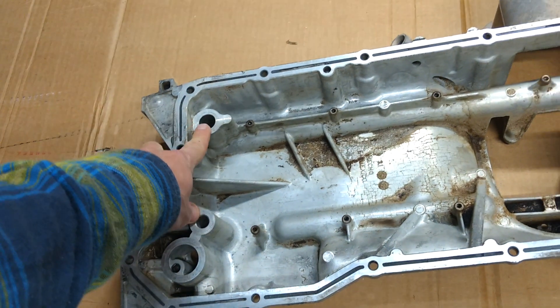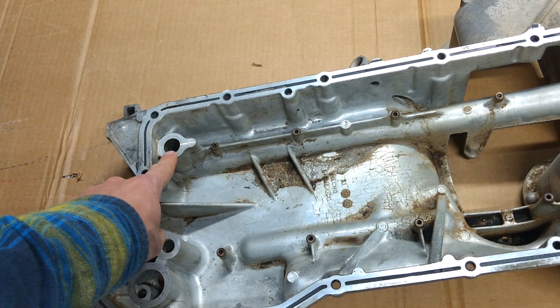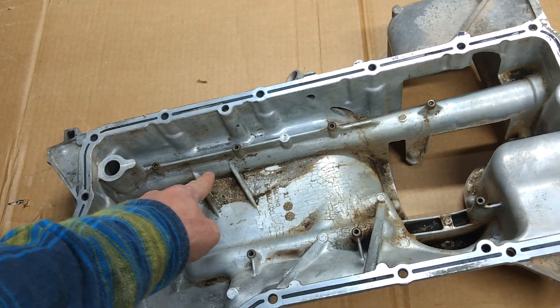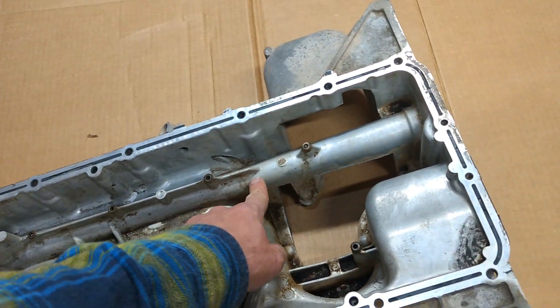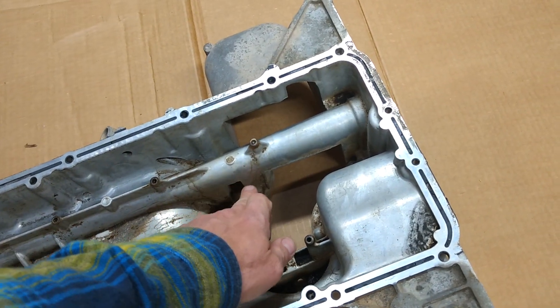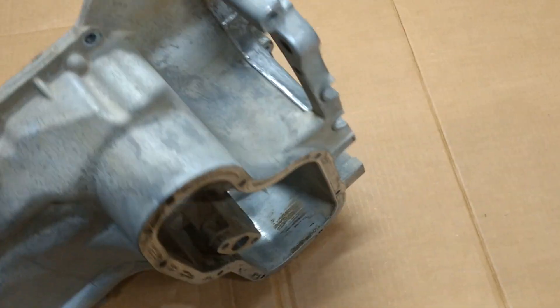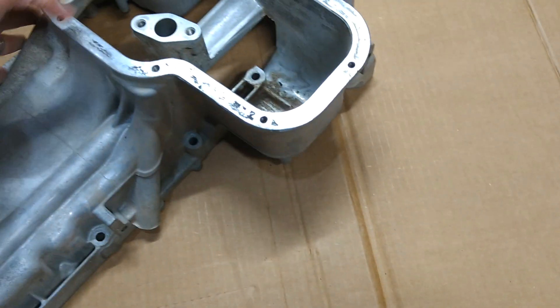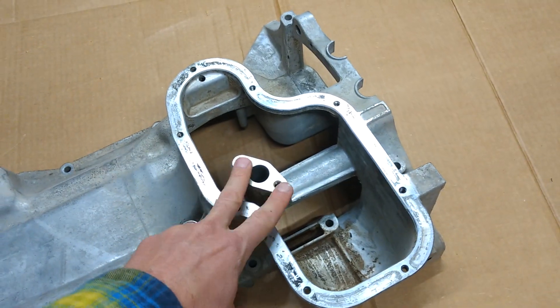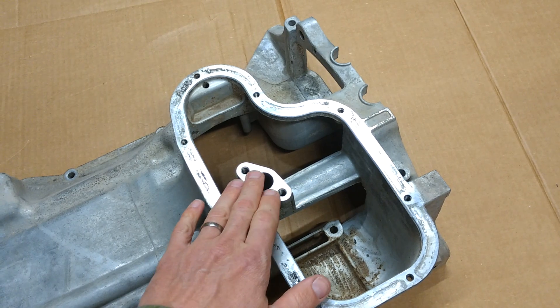Because your oil filter is there, you have your inlet and outlet for your oil to pass through. And on this side, that hole is for your oil pump — it's the pickup tube, and the pickup tube is integrated into the lower pan, coming all the way back. It's a hollow pipe cast into this aluminum shape, and that is where the stock steel oil pickup bolts on, coming out into that steel pan, and that's where it picks up your oil from.